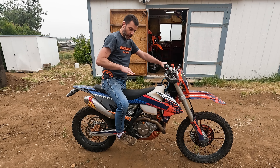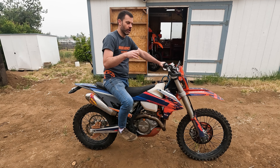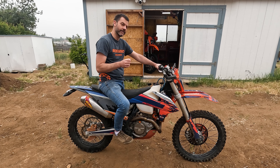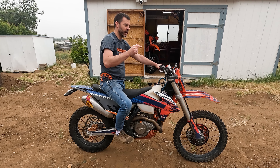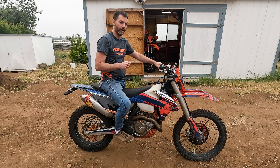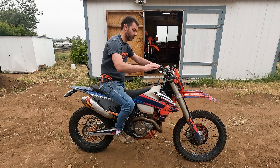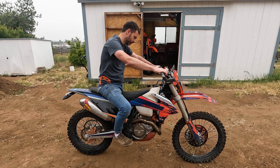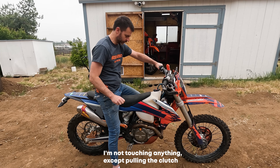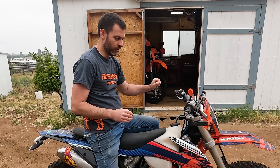We're going to fire up this bike — it's cold, not a cold day but the bike is cold — and I'm going to drop it in gear. You're going to see it immediately stalls. When I try to start it in gear it's going to drag and struggle. When I pull the clutch in, that's not going to help a ton. Even after I get the bike up and running, when I come back to a stop the bike is just pushing forward even with the clutch pulled all the way in — lots of drag on the clutch even with the lever pulled in all the way.